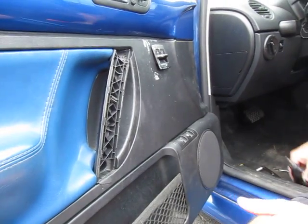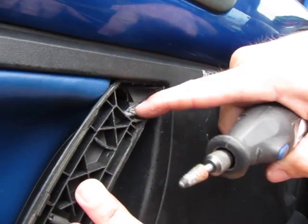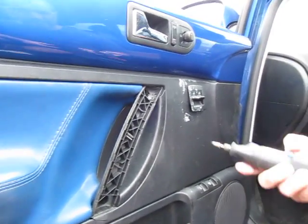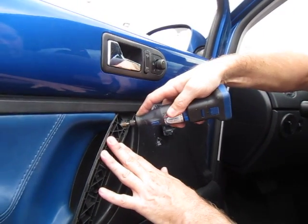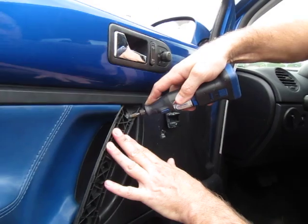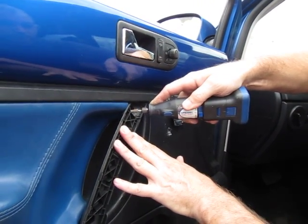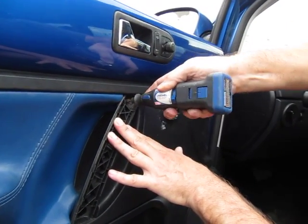And the first step is to go ahead and rough up the area. You can see somebody's already been in there and they've already tried to glue it. We want to get underneath that to get into some raw plastic to make our JB Weld hold. So I'm gonna get in there and just rough it up real good. Get down in the tube.